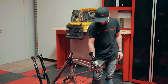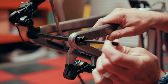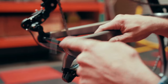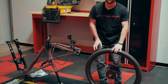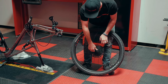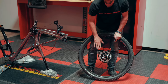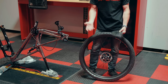We're going to remove our rear axle and remove our pad spacers. Grab the ends of the ears of our axle, slide it straight out until it clicks — once it clicks, we know it's far enough out to rotate the lever to either side — and then begin spinning in a counterclockwise direction to remove the rear axle. Next, we have a rotor protector and an axle protector. When we remove these, take care to make sure nothing is attached to the protectors. As we pull the rotor protector off, make sure we do not touch the rotor — grease from our fingers can cross-contaminate our rotors and greatly reduce braking performance.